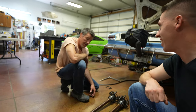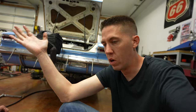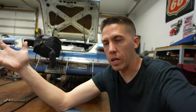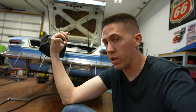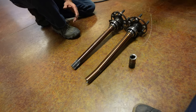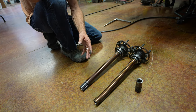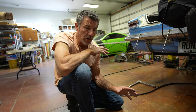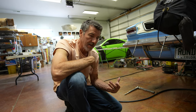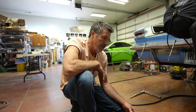Hopefully we can go out there and go 1.20 60-foot for multiple years in a row, not just once. It's pretty crazy. I was thinking about what the axles look like in the Camaro — that thing's been in the mid 1.30s, like 1.36, 1.35 60-foot, at 3,600 pounds, a little heavier than the Buick. I've done that a bunch in that car and I bet you pull them apart, you won't see them twisted. I'm not sure if the metal's soft or something's weird — I think there might be an internal problem. I know I'm not the first, even though every time I call somebody with a problem, they say it's the first time they've ever seen that. That's just a manufacturer's way of passing it off.